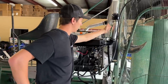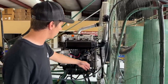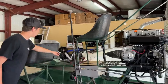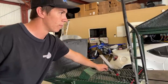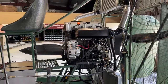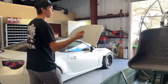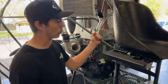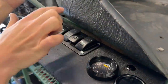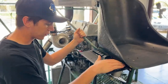We got the charge pipes done - no blow-off valve, we might never put one on, but we'll hear some cool turbo whooshes. We got the coolant system done with our line going to the water neck up to the radiator, topped off with coolant. Got our fuel cell done. We have a temporary throttle pedal - the pedal will stay but we need to get the proper cable, it's on the way. We also had to change the button panel - it cheaped out and stopped working, so we switched to a simple switch panel with bilge pump, water pump, light bar, air-fuel gauge, RPM gauge, starter button, and main power.